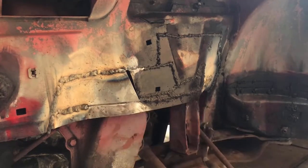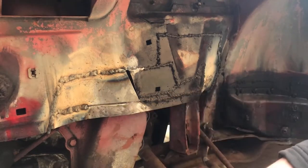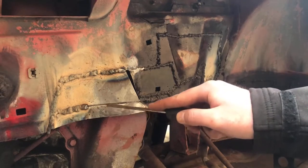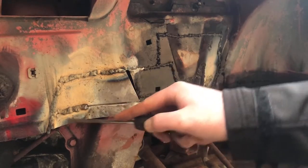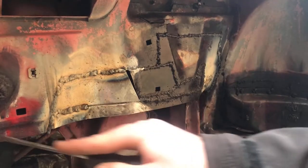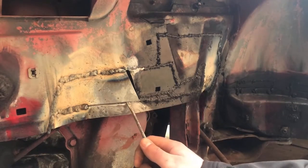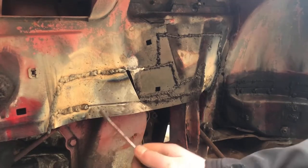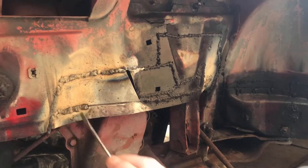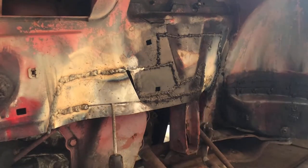The method I'm doing at the minute seems to be going quite well. So I've cut it all out, cut this bit out as well, so this bit finishes there. Instead of having a 30mm, we've only got that 20mm there now, and I've welded that to that. So this is welded all the way round up to 16cm where we start to get our angle back. I've got the screwdriver in here — that's a good weld back because there's thick metal behind it. I'm just going in and out to try and get the memory of the metal going.